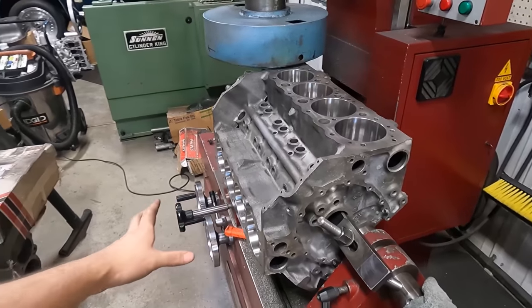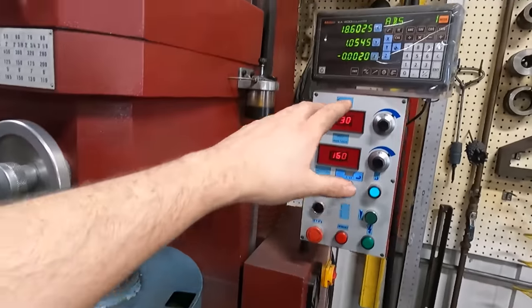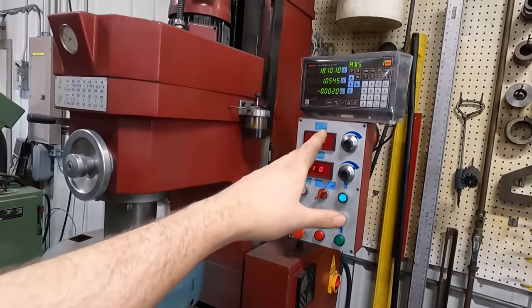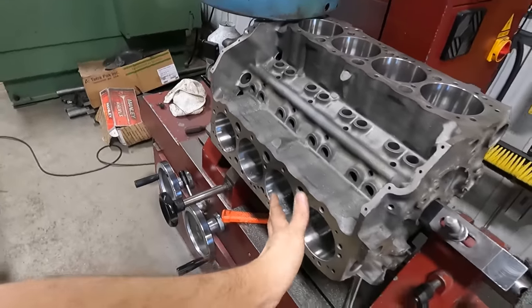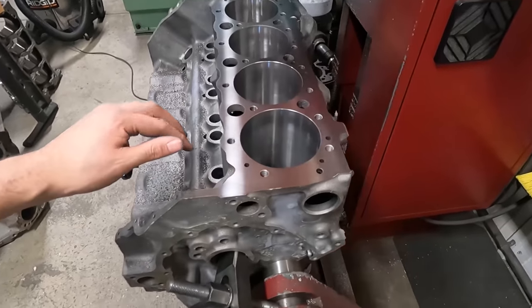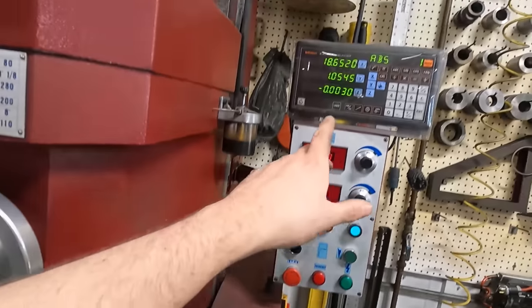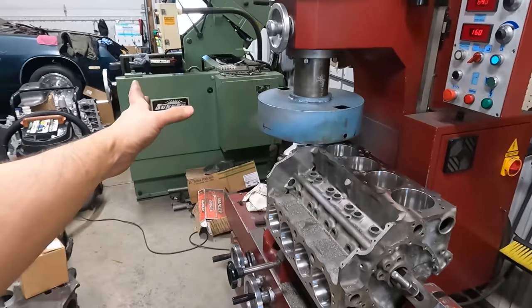I've got all eight holes bored. Now I'm just decking the other side. I brought the cutter down and it cut at about a half above where this one's zeroed out. So now I'm taking it to minus two on my first cut, and then I'm going to do one more thousandth after that to bring us to minus three — that'll be to the same deck height as this side was. After the first cut, everything cleaned up on this side, so we're not going to have to go back to the other side and cut more to make it match. With our one thousandth finish cut, everything's going to be clean and this block will be ready to move over into the cylinder hone.